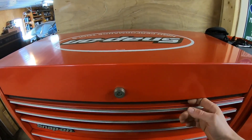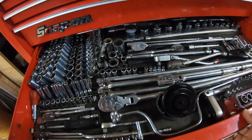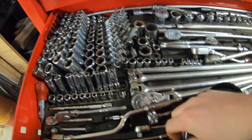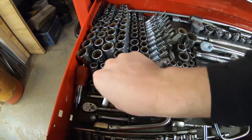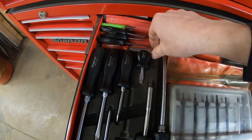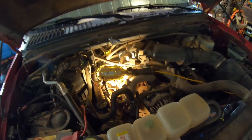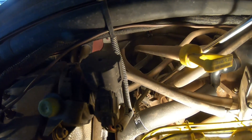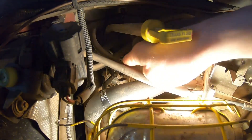I can't believe we're working on almost three months I've had the red box here already. Getting the tools together — I'll need the seven millimeter swivel, the plug gapper, and a few other things. We'll start on the passenger side first since that's the most difficult, and I'm still in a relatively good mood. These V10s aren't super horrible to work on — the back couple of coils and plugs on this side are about the worst.